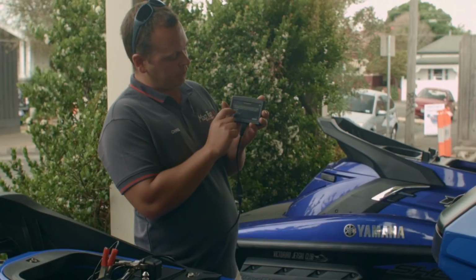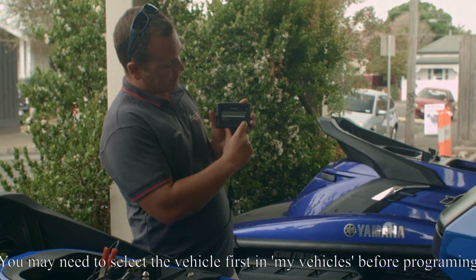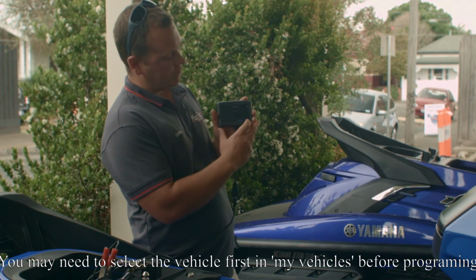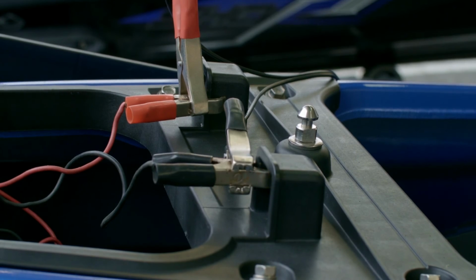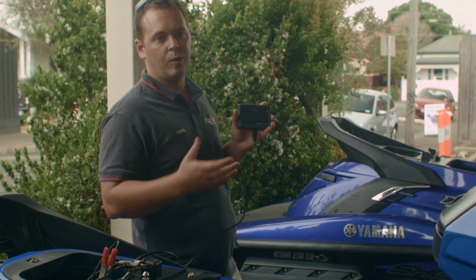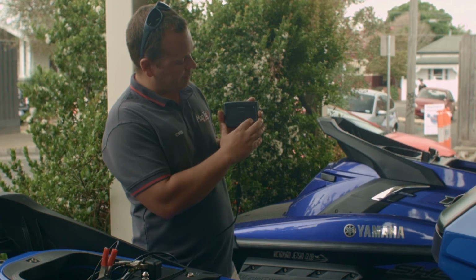So this is where we find the tune files. We'll do the 8350 tune. It's a nice and safe tune. You can actually take these up to about 8650, but ideally you want to run the safest tune for the customer where they're going to be happy with the tune. So it brings up the RPM profile.